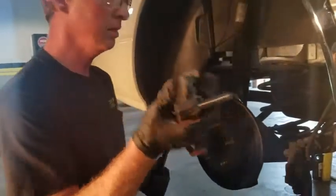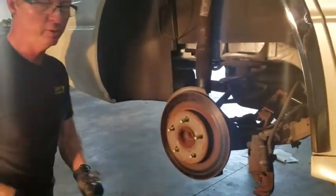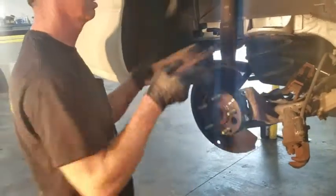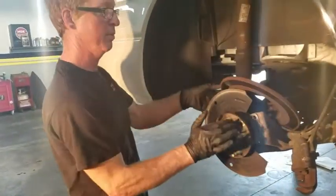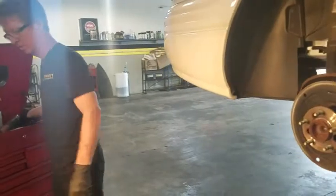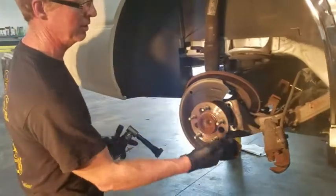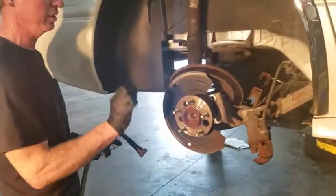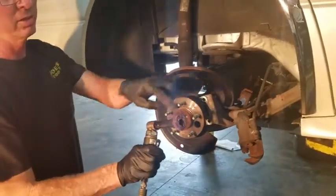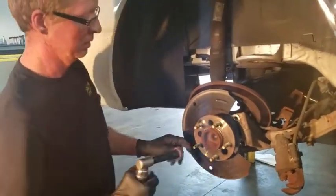There's the bracket. I'm just going to set this on the rear control arm right here. We've got a rotor — I'm going to take our rotor off of there. It's not stuck, which is nice. If it was stuck, you'd just tap it with a hammer on the outside edge and rattle it loose. You want to make sure on this hub you don't have any rust specks behind here — this one's in good shape. A speck of rust throws that rotor off.